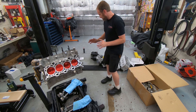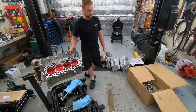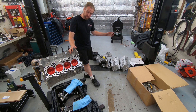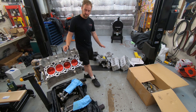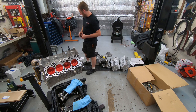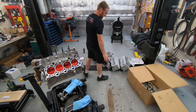The first thing I'm going to tackle is getting the cylinder heads in place, because they do not have the camshafts on them. Since they don't have camshafts, I don't have to worry about valves being open and interfering with the pistons, so I can freely turn the motor. There's an obvious timing mark on the crank sprocket, so I don't have to worry about that.